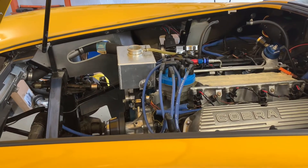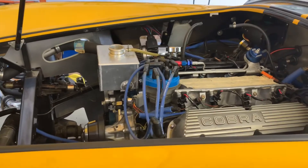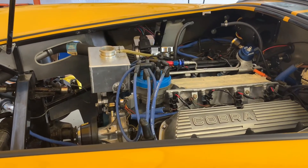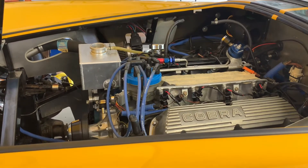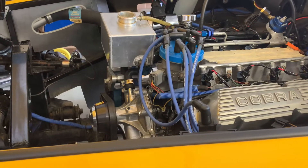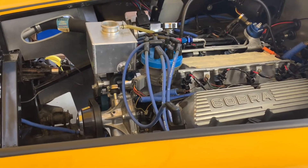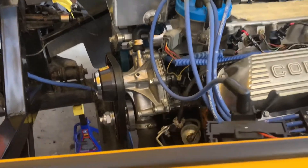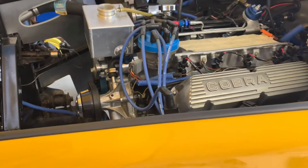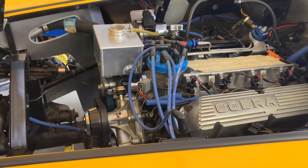Welcome back. Getting back to work — when we left off I had put some coolant in the system after buttoning everything up except for the upper intake manifold, let it sit overnight. Everything at the thermostat housing and overflow looks good, no signs of leaking. I did find a little bit on the hose that comes off the water pump, so I tightened that clamp up — it was loose. That's where it was seeping out of.